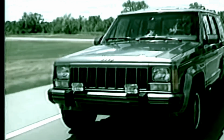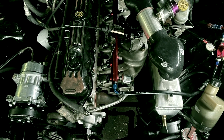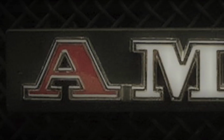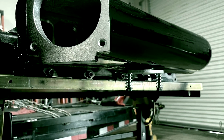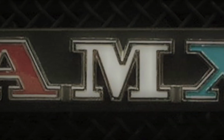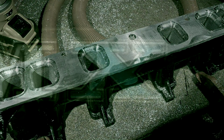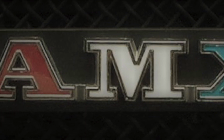So are you talking internally the block was moving around fore and aft, or the whole motor? Well, no. Basically the bottom end of the block, like the caps and stuff, was vibrating back and forth from end to end. Okay, it's the caps. Really? And they were vibrating at different frequencies. So they said, well, you know what, we were looking at the bearings and wondering why the wear is on the outer edges of some of these bearings.